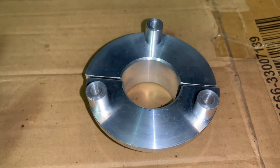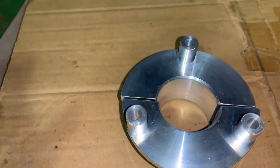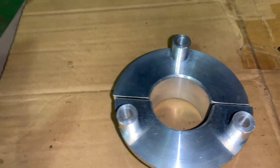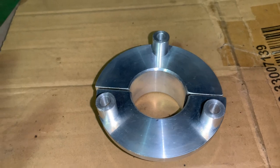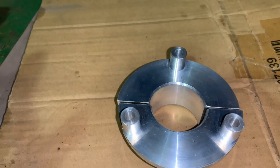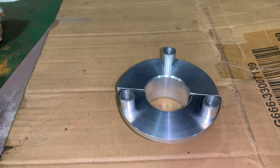I am a big fan of the aluminum sprocket hub mounts - they turn a lot straighter than the rag joint. Over time the rubber does not shrink and make my rear sprocket loose, because those rear rag joints do that from time to time. They're good in some applications, but I prefer to run a nice aluminum hub mount. After I get it positioned and tightened up, no more maintenance - never have to touch it again unless you're removing it from the rear wheel.